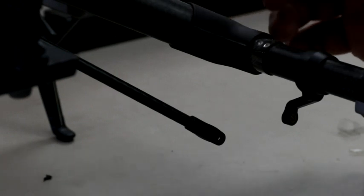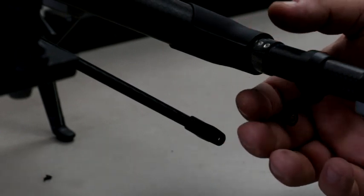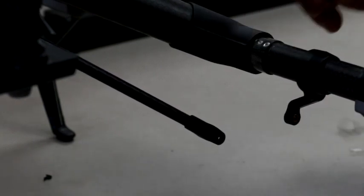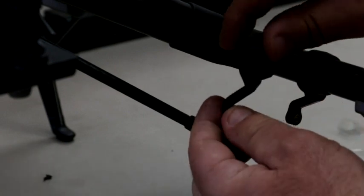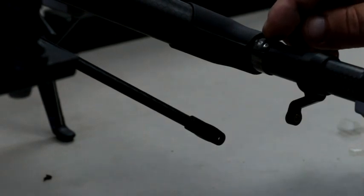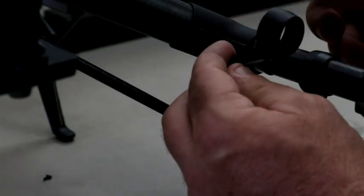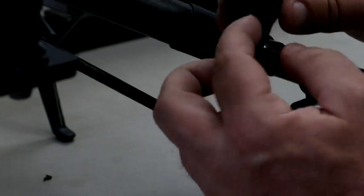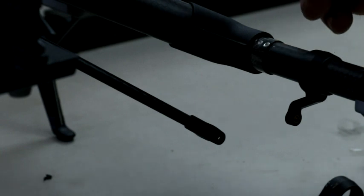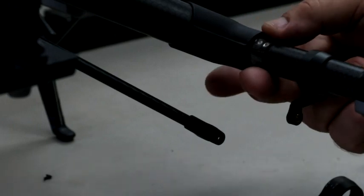That's actually what's keeping the tension, filling up a little bit of the space between these grooves. On here, you have grooves, and then also on the clamp itself, there are grooves. And the problem is that those grooves are metal and they start to wear. The more vibration there is, up and down, any sort of rotating at all, these grooves will start to wear, metal on metal. So we replace the DJI tape, and this is definitely a much better solution.